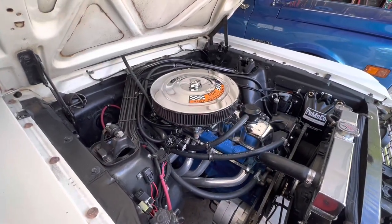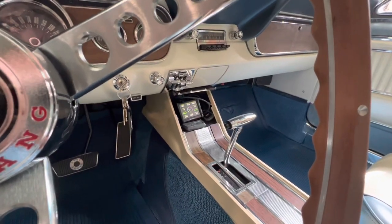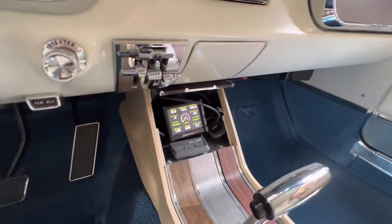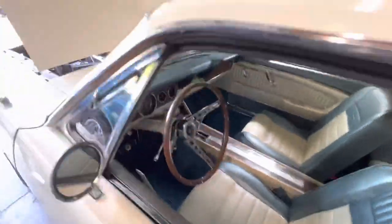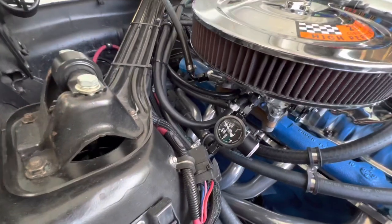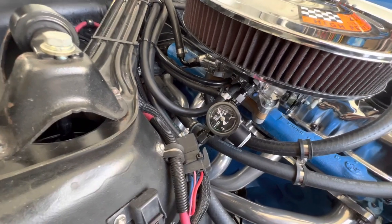Let's give it some time, a little warm-up. So we're up to temp here. Doesn't really seem to have made much of a difference as far as idle quality or anything like that — I wasn't expecting it to. I do see the learn data is kind of out to lunch a little bit, showing minus 4%, but the learn is minus 22%, which means it previously learned that amount but it's not right now. So it looks like it's idling about the same, but it is maintaining pressure. I don't know what it will do when you're wide open and demanding a lot of fuel if some of it's going to return. It does look like it's staying up in the 60 range — not going high and then dipping low, at least not yet.